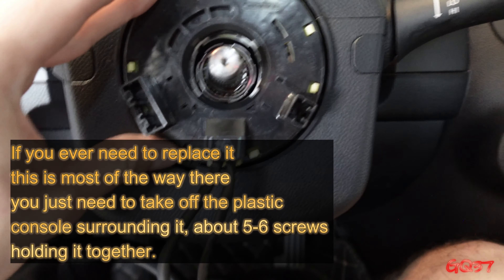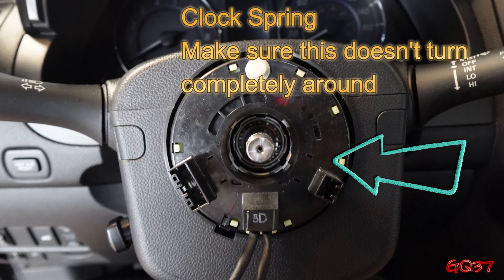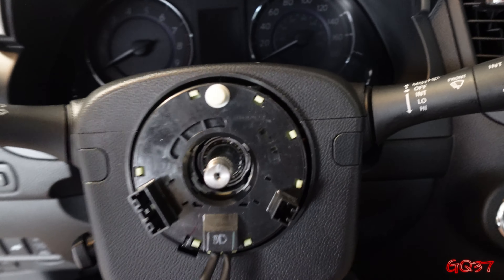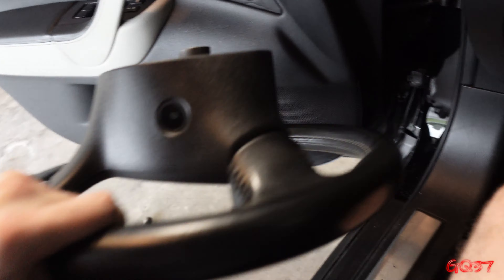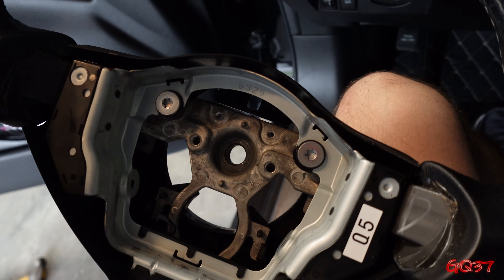If something's acting funny or works intermittently, it's usually the clock spring. Do not turn it all the way over in the process — make sure it doesn't completely spin around. If it gets off center, that affects your steering control and ABS. If you get that messed up, when you fire your car back up it's not going to drive right. So make sure it's the way it's supposed to be.